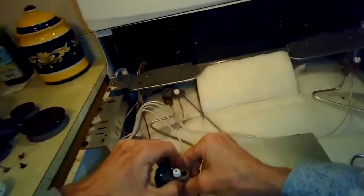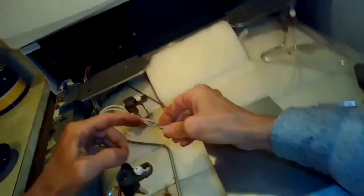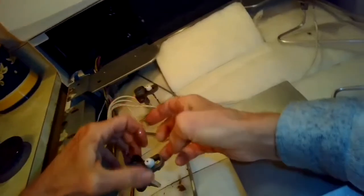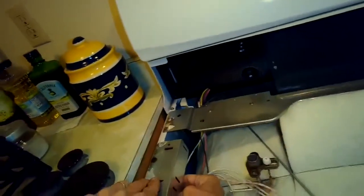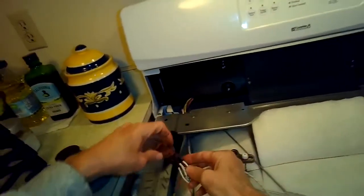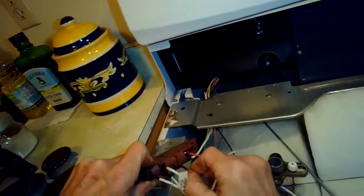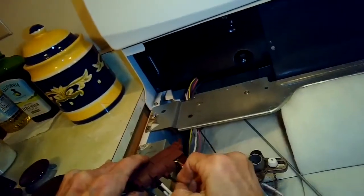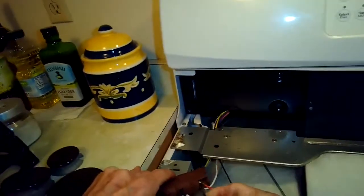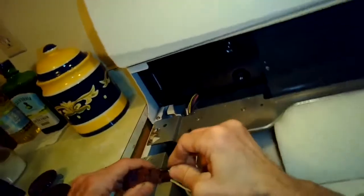Here are some of the components: the tube that brings gas to the burner, and the igniter — I just took the wire off; it's a spade connector that slips right off. This is the igniter that wasn't working. I'm checking its connection to the spark module, which lives right here underneath this plate. The spark module comes out easily — just push in on a couple of tabs. I'm checking the connection for that one wire that goes to the left front igniter that wasn't sparking.